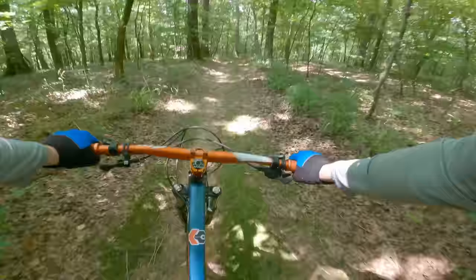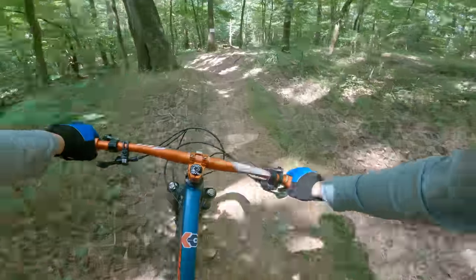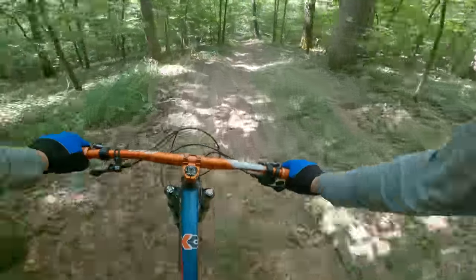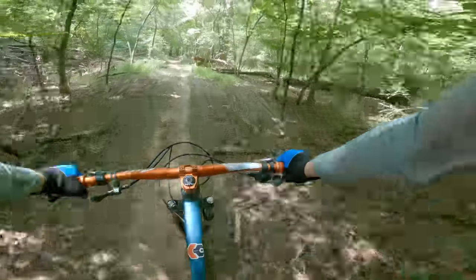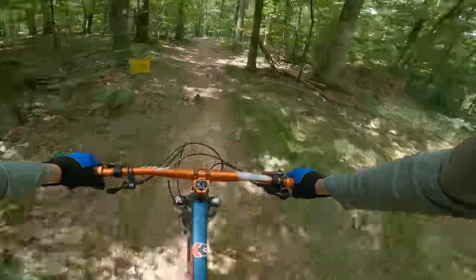The front fork is amazing also — it slightly changes the bike's geometry, making it slacker, but not enough to make climbing hills noticeably more difficult. This is full suspension so it's not hardtail-climbing easy, but the new weight helps. I was hoping to get this down to 32 pounds, and my guesstimations were good — it's 32 pounds even. Traction — coming off riding the Axum with its tubeless setup, I've kind of handicapped the Mountain Kings by not running them tubeless, so there were a few kickouts, but that's to be expected running high pressure in tubed tires. Five minutes into this intro ride, I knew: this is by far the best full suspension project bike I've yet created.